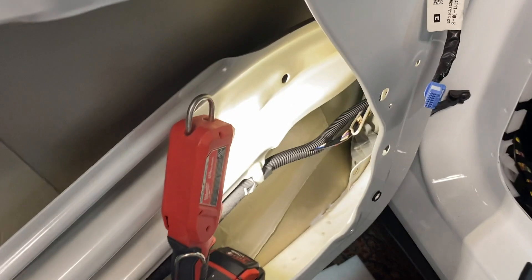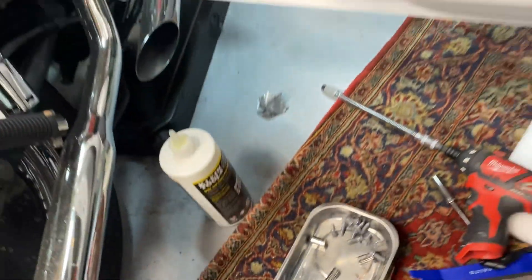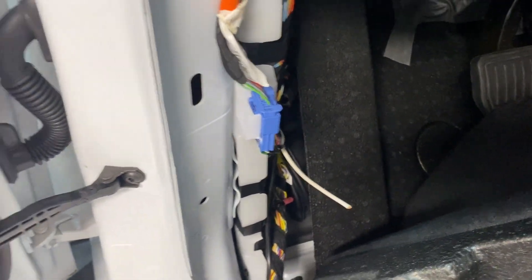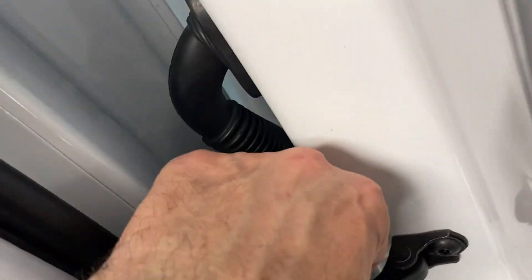Like before, I just fish this wire through there. I use this synthetic premium wax to get that thing slicked up so it goes through all that conduit and out the other side. Now we'll pull the wire through and move on. I had to take off the rubber piece to get it to come through, but it's coming through now, all taped up. Just stick that through there, push it back together, and our wire will come out over here.